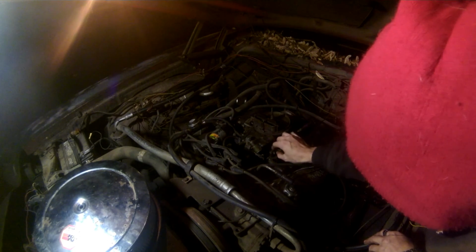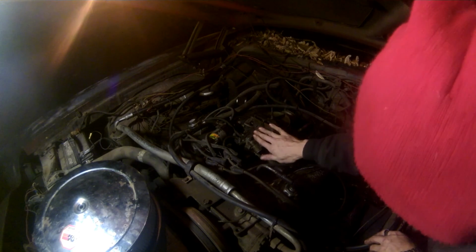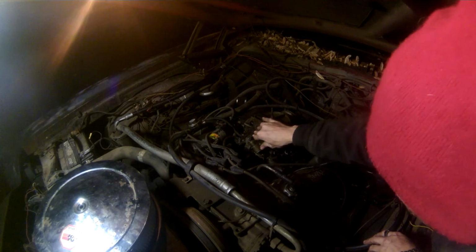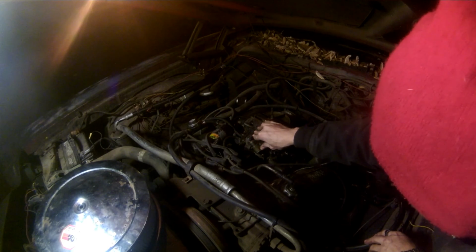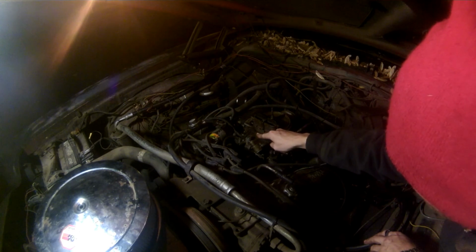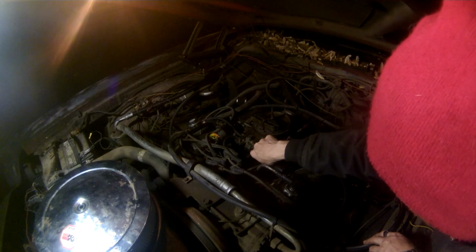So basically, what keeps happening, and I've seen it before on this particular carburetor several times, and I think I've figured out how to remedy it as well, is that vent body baffle, that little piece of plastic I was telling you about, keeps falling off and sinking down underneath the float in the carburetor bowl.